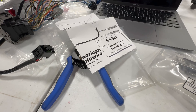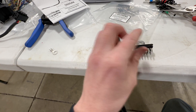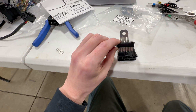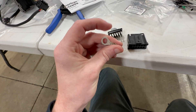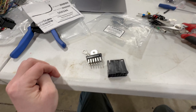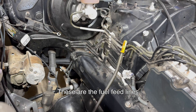For the chassis grounds I picked up this American Auto Wire instrument cluster grounding kit. It's basically a bus bar — I can terminate all my chassis grounds into this connector, which plugs in and connects them all together, mounted to the engine. You could just use a ring terminal like I did on the Supra, but this is a little cleaner and easier to add to in the future.